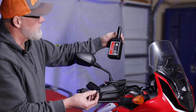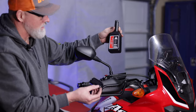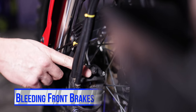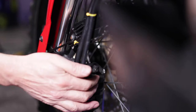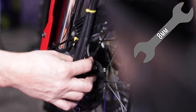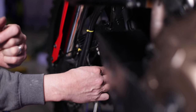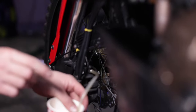There's a little bit of residual left and I think we'll get that cleaned out when we start bleeding. We're going to use DOT 4 — this is the Honda DOT 4. Any DOT 4 will do but just make sure you're using the right type of fluid for your bike. We're going to fill this up and start bleeding. With the reservoir full of new fluid we're going to come down to each caliper and find the bleeder valve, which has a rubber boot on it — we'll remove the boot. This is an 8 millimeter. Just use a gas line hose that you can get at your auto parts store and make sure you get the right size so you don't suck any air in.